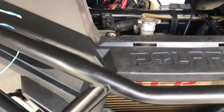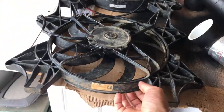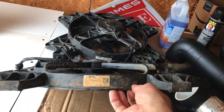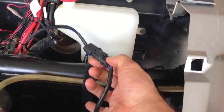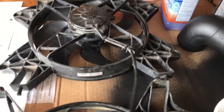This fan seems to be a lot stronger — that's definitely a bigger motor on the fan. The fan blades are the same size. This is the OEM factory fan, and you can see the difference in thickness and how this one has a bigger motor. The plug was still the same; it matched up. I wasn't too concerned about that — I could always cut it off and straight-wire it with some butt splices and heat shrink, and it'd be fine.